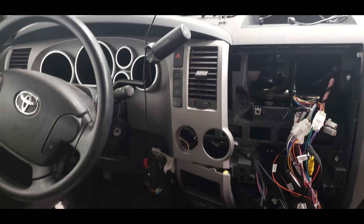I don't have the remaining steps to remove the radio on video, but once you get the AC panel off, there will be four screws — two in the front and two that are recessed. Remove all of those and the radio is free to be pulled out. You'll have to give it a tug to get the snaps to release, and then you can unhook the harnesses.